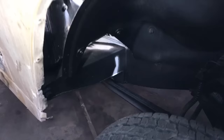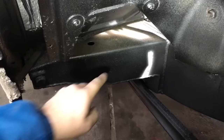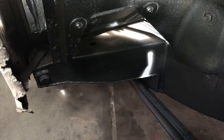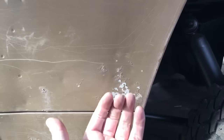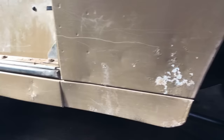At the front, inside the front wheel arch, is the area called the front outrigger, which supports the bulkhead off the chassis. You'll quite often find corrosion on the front surface — it might have been patched on top. Water tends to run down into this area, so it's a suspect. It can be cut off and re-welded or patched, but try and make sure it's sound and that any welding is a decent job. You can also notice oxidisation where aluminium has had water or mud trapped behind it, causing the paint to come off.